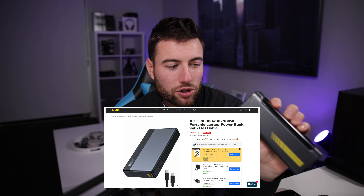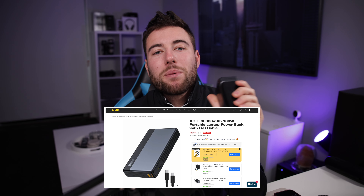There's also a smaller 30,000 milliamp version available if you're interested. The main downside is the size — you can't travel with it on a plane because the limit is around 100 watt-hours, and this one is upwards of 144 watt-hours. It also weighs 900 grams, so it's a behemoth. But for road trips, remote work, or anything around the house, it's a great portable power station.